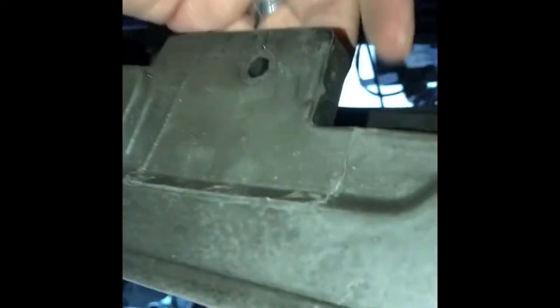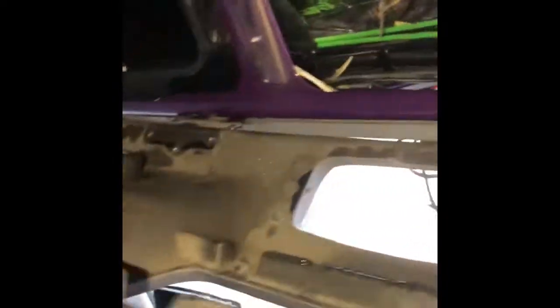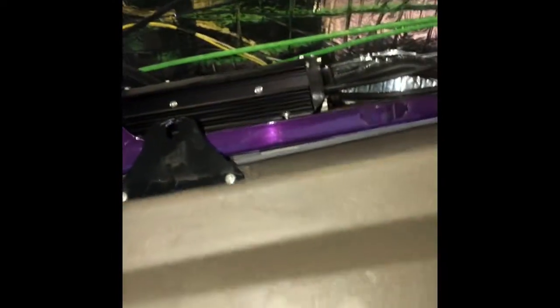These overhead pocket pieces just set up in there — they don't screw into anything. That's how you take it apart; it goes back together in reverse. You also have two screws on the top of the center console and two screws up here that you have to take out. Other than that, that's it.